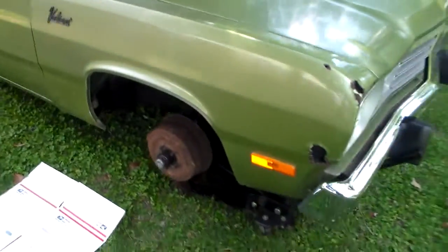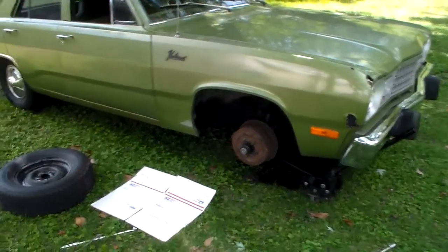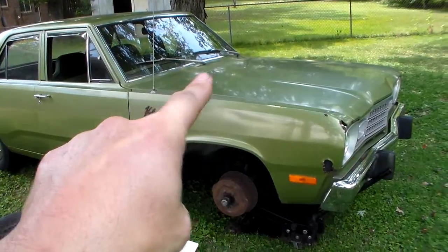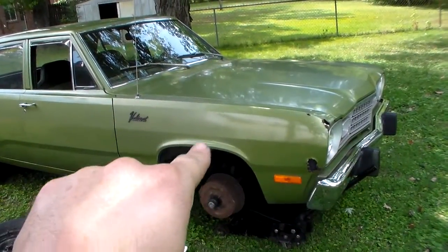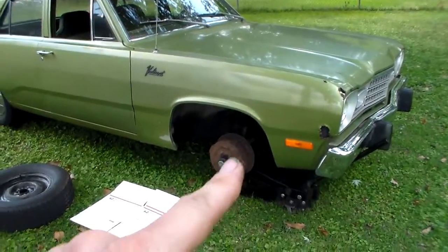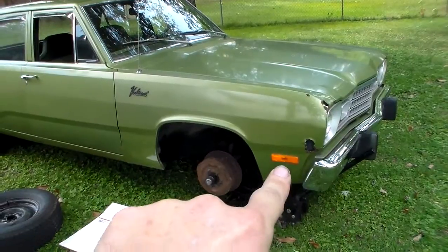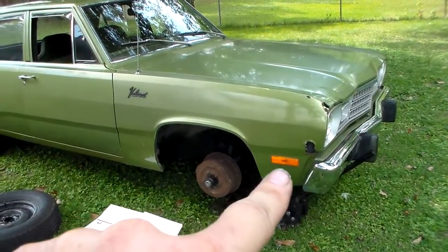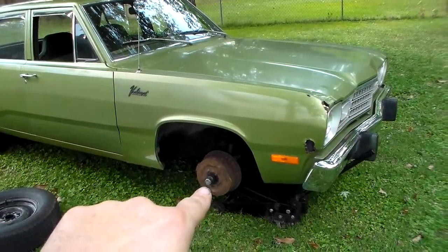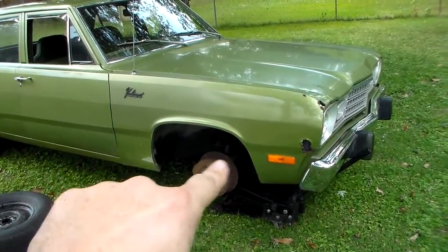Here's the deal with brakes — the way I approach a brake problem is exactly the same as an electrical problem. If you have a light that's not working or a brake out here that's not working, the last thing you want to do is go to the very source and start diagnosing there. You don't want to go to the battery, or if it's the brakes, you don't want to go to the master cylinder. You start at the device — that's where you start your diagnostics. We're going to start out here at the brakes and check stuff until we find where the brake fluid is stopping or what's not working. That's how you approach things like that.